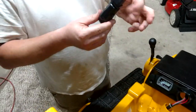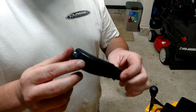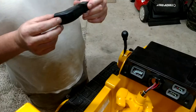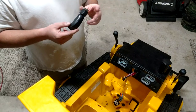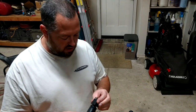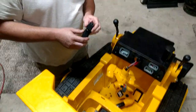And that is how you clean these little contacts. It's a lot cheaper than having to track down new ones, which I've had to do in the past and it's a major pain. It's a lot easier to just pull these apart, clean them up, and put them back together. If you leave the toy outside, it's very likely to happen again — you may have to do this every four, five, or six months depending on where you live and how wet it is. In a dry climate you'll probably never have to do it. Then it's just a matter of putting everything back together in reverse order. Thank you for watching, bye.